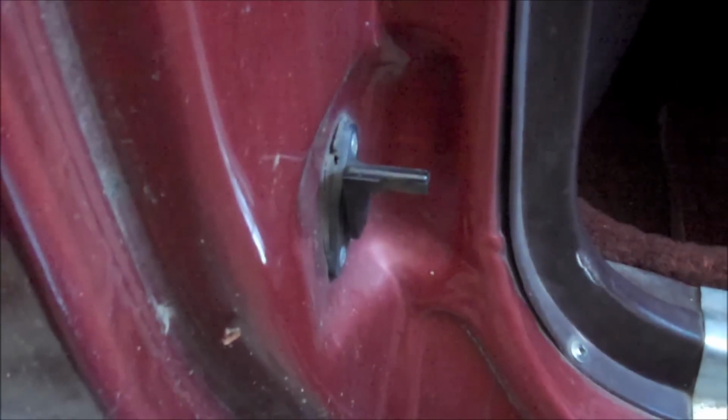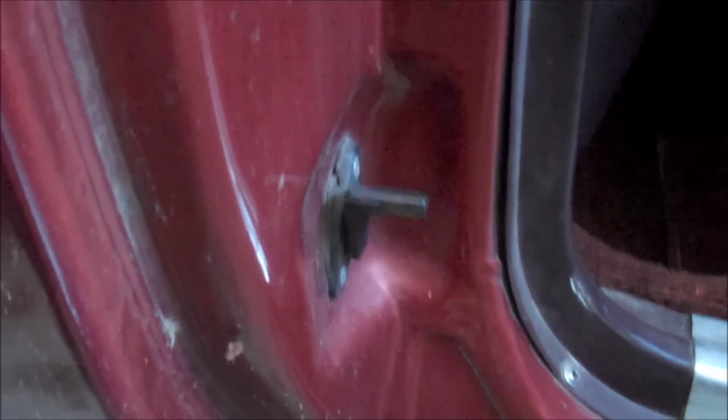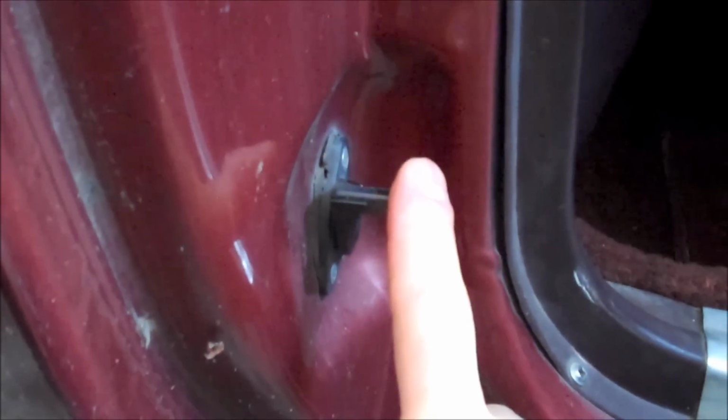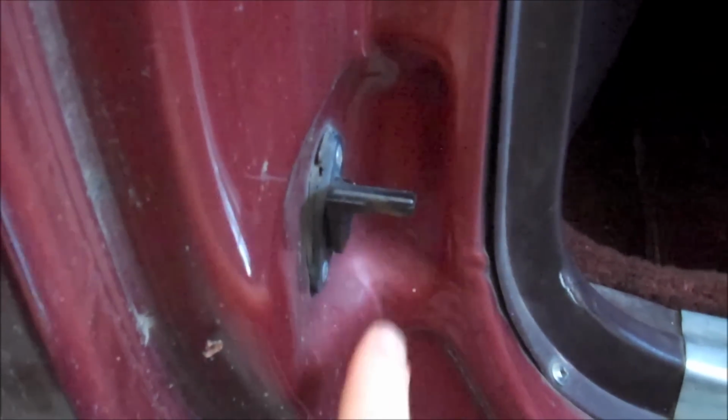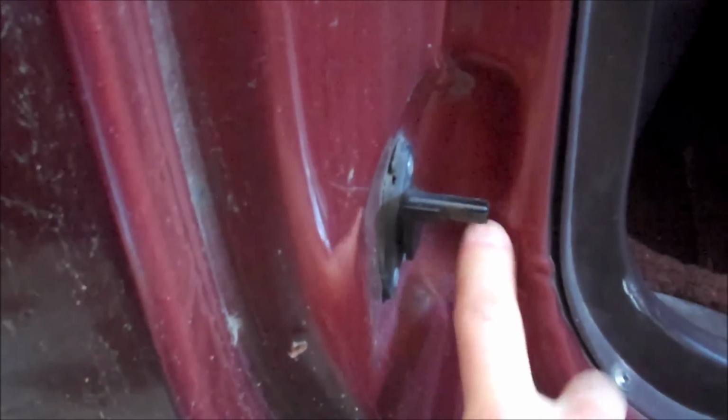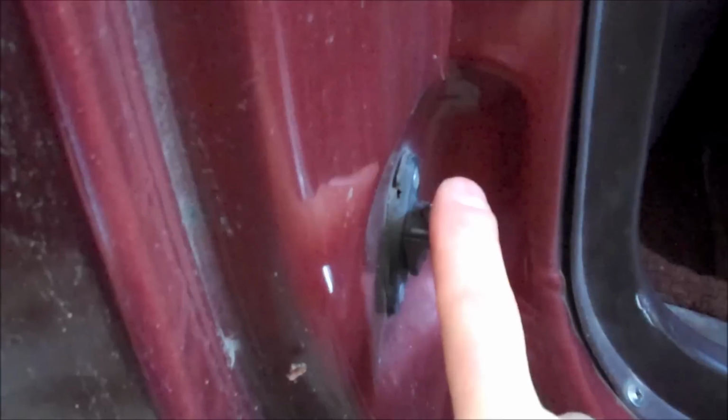Okay, so the seatbelt retractor lever is located down in the corner of the door jamb on both the passenger and driver side doors. Now, a four-door and wagon do not have a mechanism that looks like this. Their mechanism is a plunger that plunges in and out of the door jamb. So those do not commonly break like the ones on the two doors do.